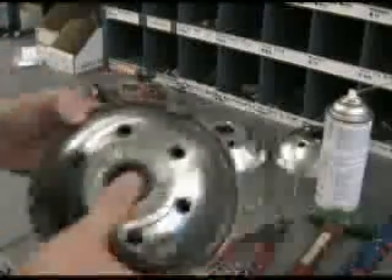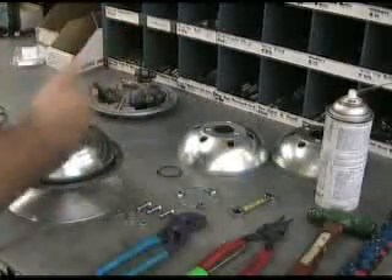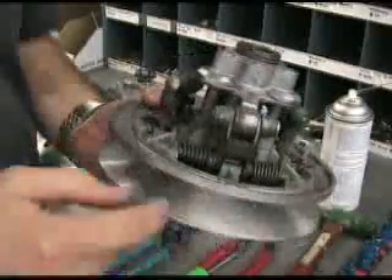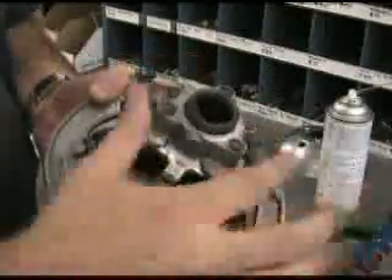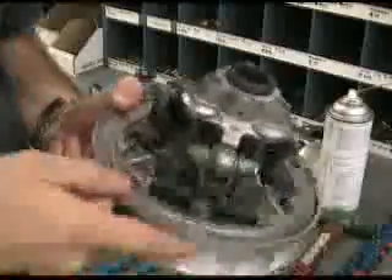On the rest of this transmission, you've got a movable face, which is this plate right here. On the movable face we have these cams: a cam roller here, a cam arm here, and cam springs here. Generally you would never really replace one of those individually — you just replace the whole movable face. Moving up, you've got the spider, which is this piece right here with these three holes in it. The spider has these three arms with guide arms that keep this movable face moving with the base plate. It acts as a guide.